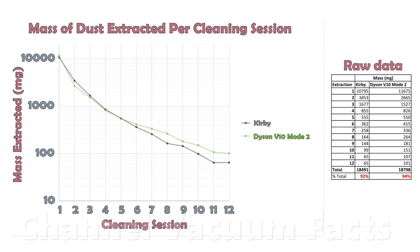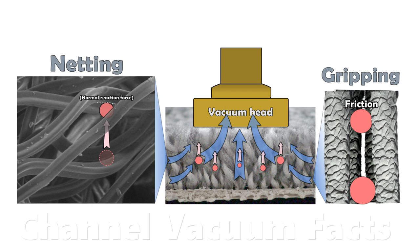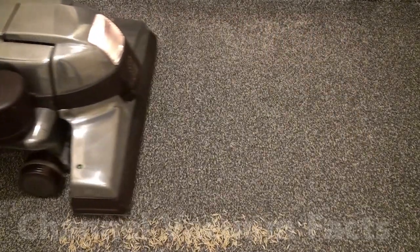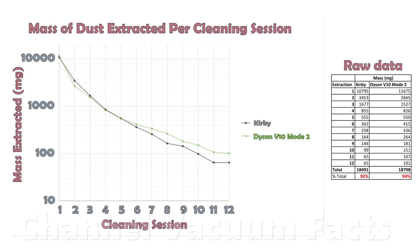Firstly, removal of dust from carpet is always statistical, even when you have more airflow from beneath the pile with porous backing. Dust is always left behind, and more is extracted with each pass, as discussed in description links 6 and 7. This is because particles are netted and trapped within pile fibres, and more than brute force air flow is required to remove them — they need to be physically dislodged. An aggressive brush bar also doesn't help, because fine dust doesn't respond as well to aggressive vibration, unlike larger particles like rice. Pile needs to be separated and flexed, and the V10 cleaner head does this really well, as clearly shown in the data.